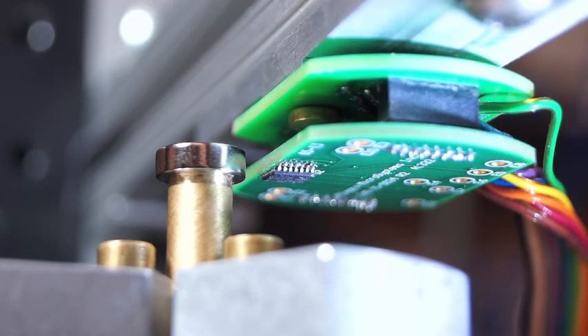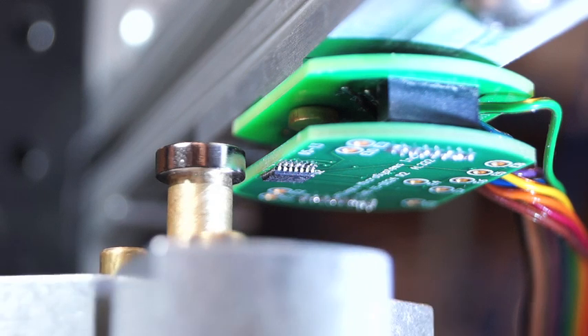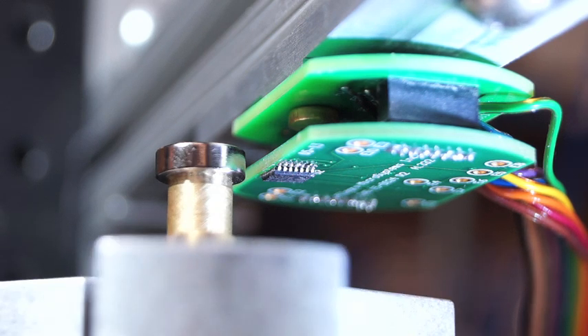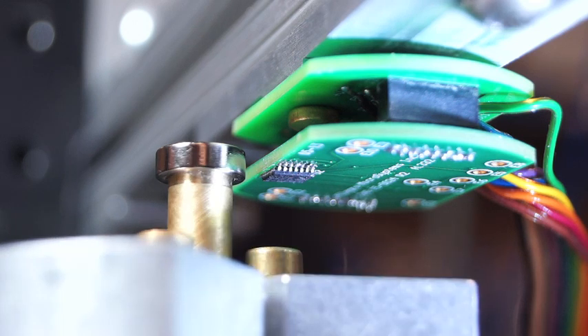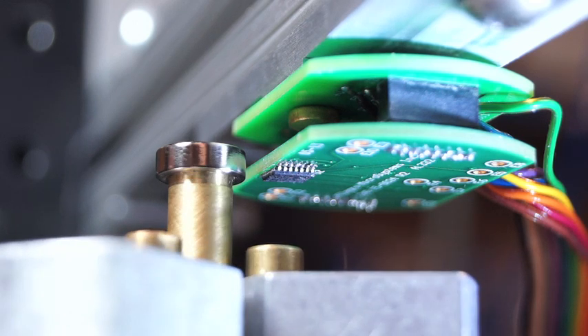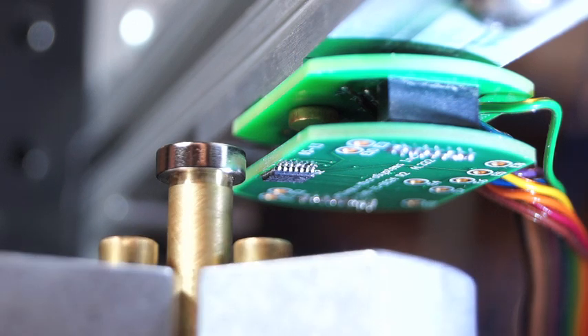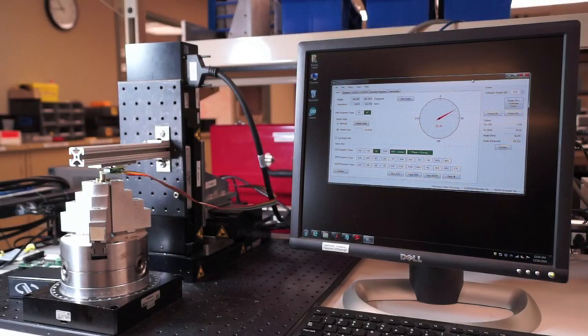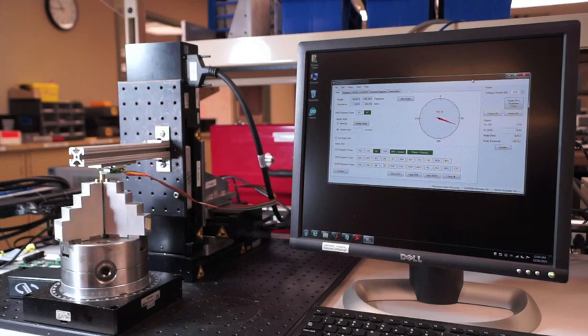The rotational movement of the ring magnet represents the steering wheel position inside a vehicle. The steering wheel rotational position is critical for the EPS system and works in tandem with the magnetic torque position sensors to determine how much current should be applied to the EPS motor for turning the vehicle's front tires. Note that as I rotate the mechanical assembly, the ring magnet rotates and you can observe on this display the corresponding change in angle measured by the A1332.